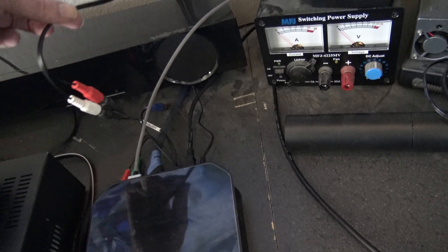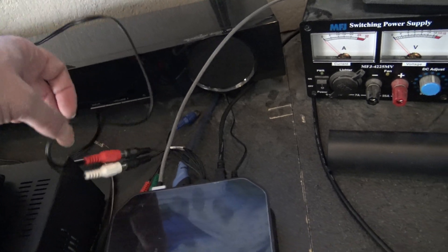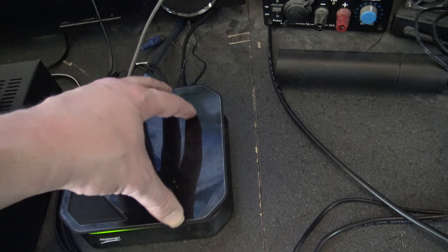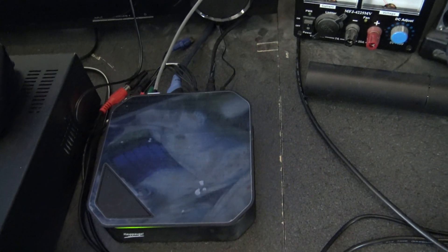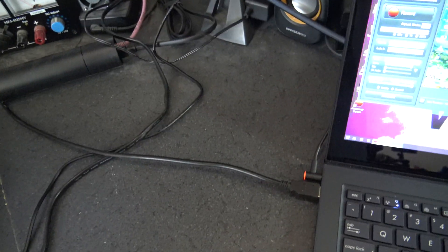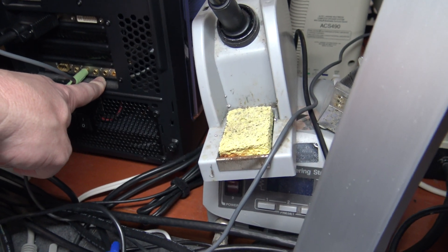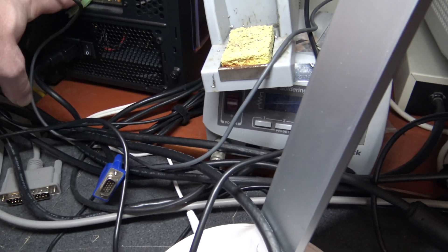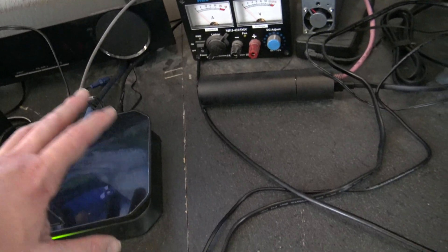This also handles audio. Right now it's got an analog input plugged into this VCR — I'm doing some capturing for a housemate. That analog audio capability is what really made this work for my use case versus the Elgato and more modern solutions. Even though analog capture was an advertised feature of the Elgato, I could not get it to work, whereas this one works great. An old video card won't output audio through HDMI, so I use analog from the Audigy 1 sound card — one output to speakers, one to line out, which feeds the capture device. Audio syncs up perfectly with no post work needed.